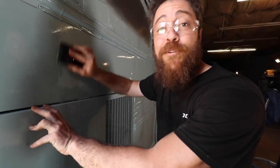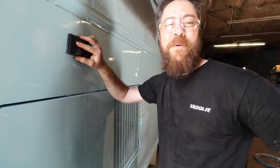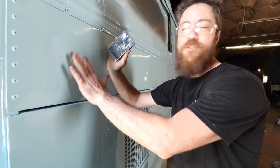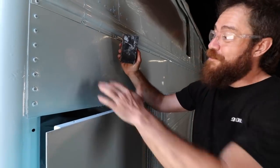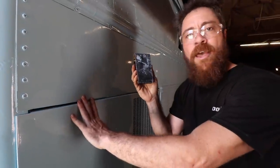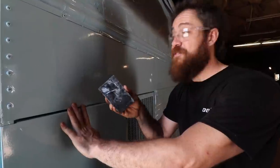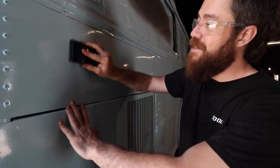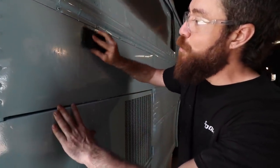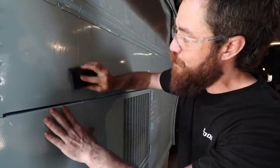So huge shout out to a few of our viewers, What Do You Know and Craig Ellis. And I think there was a lot of other people who were mentioning that when dribble drips happen, because obviously we're not professionals, so drips do happen. So they were saying get dry, wet sandpaper. So we've got 800 grit automotive sandpaper here, getting it wet and do a little wet sand on it. And you'll be able to smooth out that dribble drip area without being too aggressive on the paint itself.